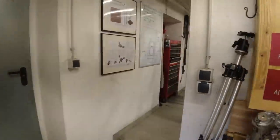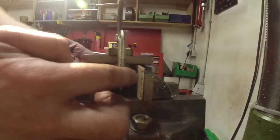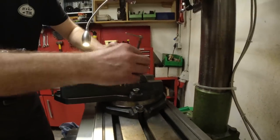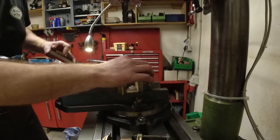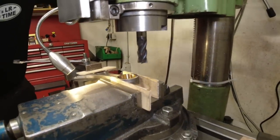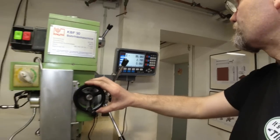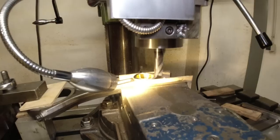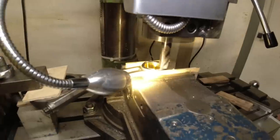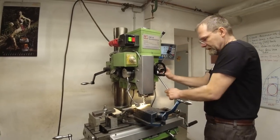Let me show you my setup. I clamped the connecting rod to the top surface with a little C-clamp, then clamped it in between wood, and over here I have a support. This is not a machinist's dream. But if I open this up, the connecting rod will actually be flat right where I want to machine it. It's a carbide cutter, so I hope this is clamped good enough. There we go. Now we've got to turn this around and do the cut on the other side.